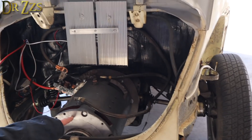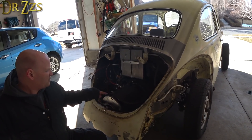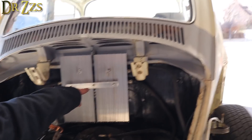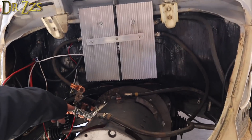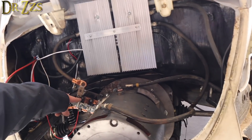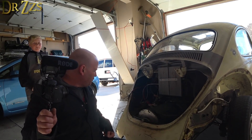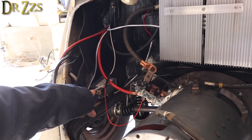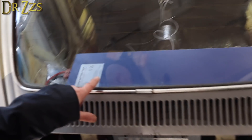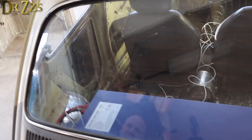Forklift motor, supposed to run on 48 volts. We've got it running at 96 when it's max throttle. This is the motor controller I got from Hungary, from eBay. This is a main contactor relay that I got out of the forklift. A lot of the wires came out of the forklift. There's a 96 volt to 12 volt DC converter there, and then a battery pack here that I got from China. That's lithium iron phosphate, 100 amp hours, 96 volts.